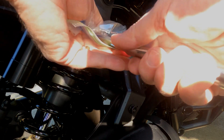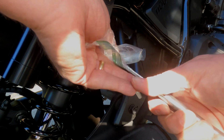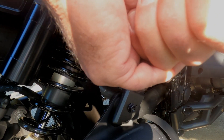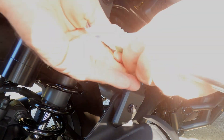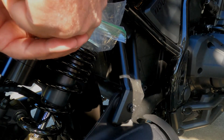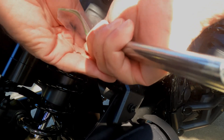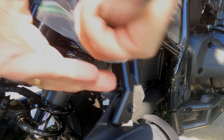The shock absorber adjustment sprockets are located just above the two coil springs on each side of the rear tire. To help protect the cool black adjuster finish, place a small plastic bag over the business end of the adjustment tool. If your zip tie test indicates your rear shocks need more preload, start by turning the adjuster two clicks. Use the same setting for both rear shocks.